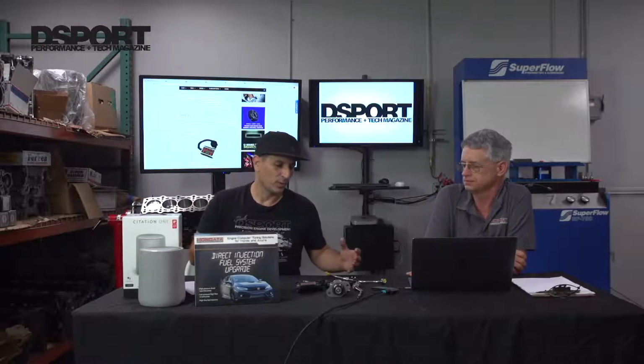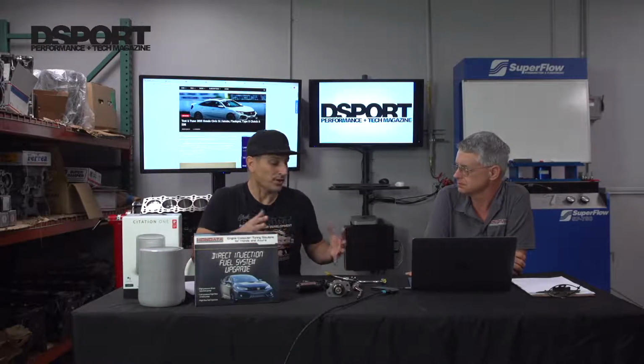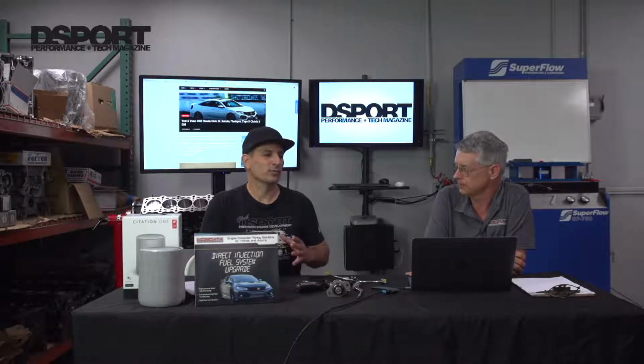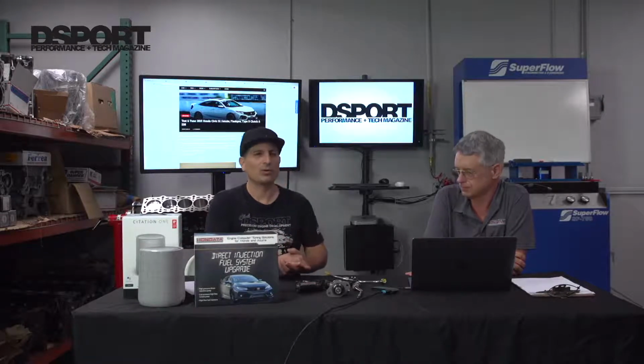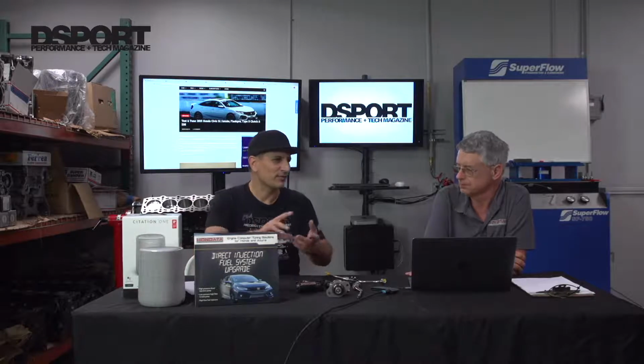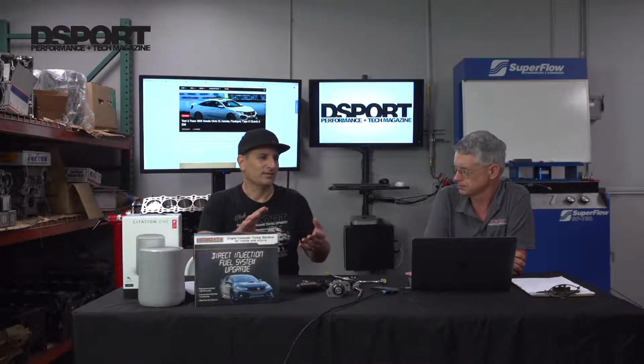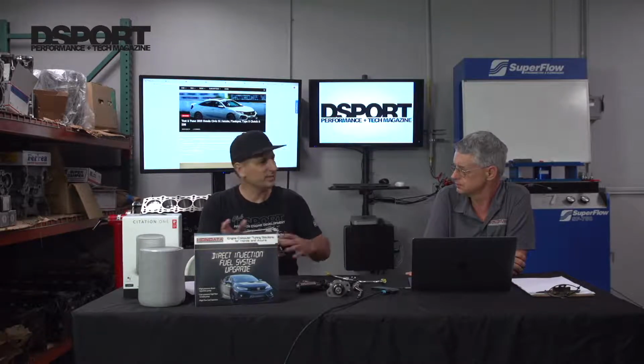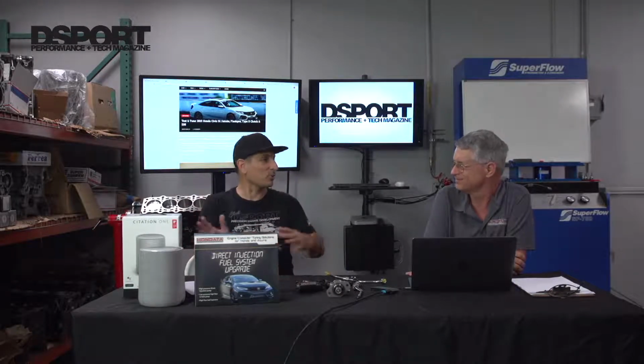I think one of the big challenges with the new Honda platforms for tuners is that tuners aren't familiar with direct injection. It's a whole new set of rules. If you try to run the same timing and fuel strategy that you run with a port fuel injection engine, it's going to be completely off the charts from where you need to be.